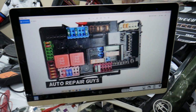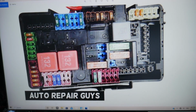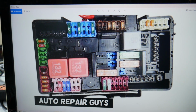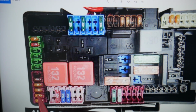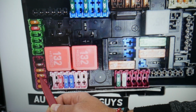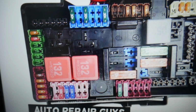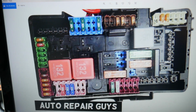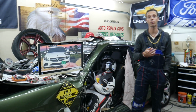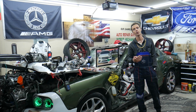Here we need to start by checking 2 fuses, then we'll talk about the relay function as well. So what do we need to do here now? Coming in this row of fuses, we need to first check fuse number 452, that's 450, 451, 452. You see that fuse here? That's the first one. And then you need to check 453. These 2 fuses are the ones that you need to check. What about relays? Except these fuses 452, 453, you don't have any relays. These fuses are known as relay fuses. Those will be the only ones that you need to check. If you still have problems with the system, we recommend to check the codes and see what's causing your problem.